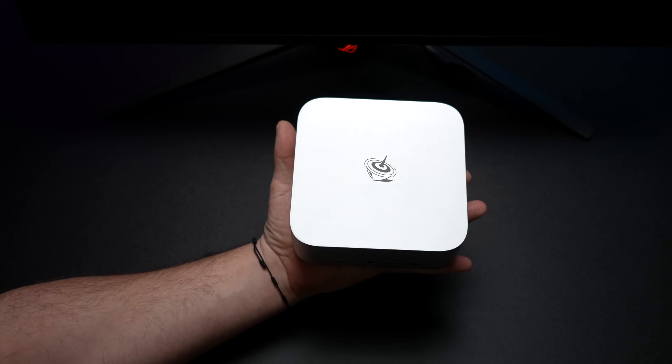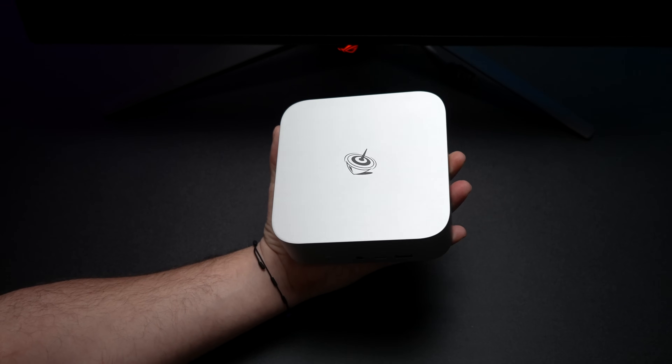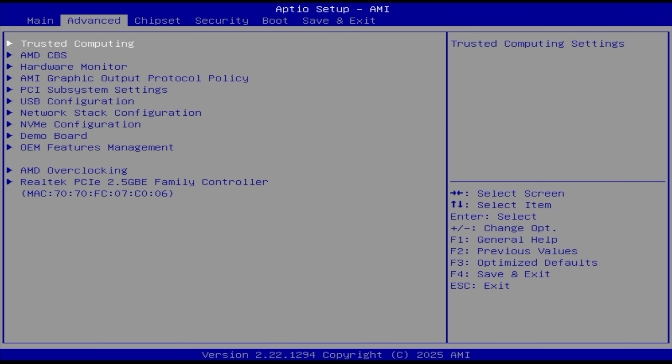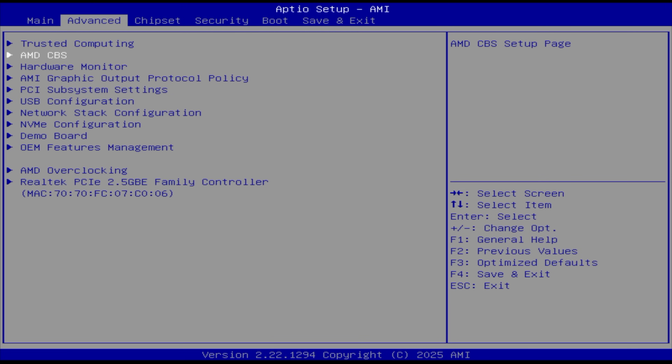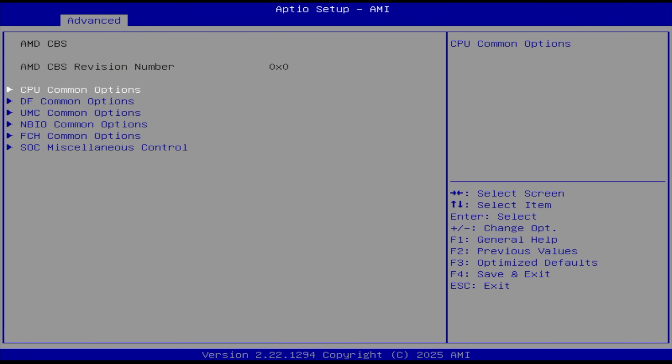In order to get this overclock, the first thing we need to do is make some adjustments to the BIOS. We're going to do most of it from the BIOS here. From the advanced section, we've got AMD overclocking. But there was one thing that's missing — usually from AMD CBS, we have another option that'll allow us to up the TDP. From the BIOS I can't do it, so I'll have to use a third-party app. I've tested it and it does work.